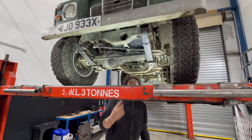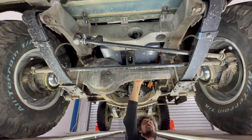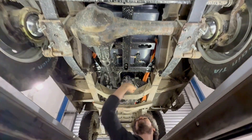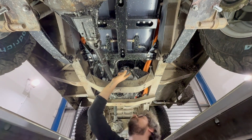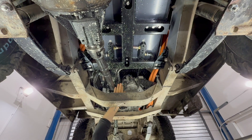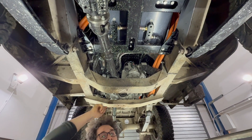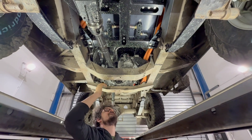If you follow me, under here you can see all the mounting brackets and everything for the UBP — that's the underside of that. All your fuse boxes and stuff are tucked up in there along with your bi-charger, which handles your charging, and then a DC-DC converter to give you 12 volts to a battery — so that runs a bit like an alternator on a conventional motor.